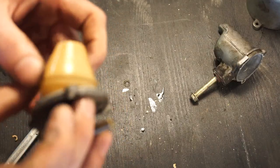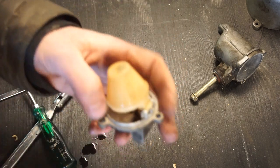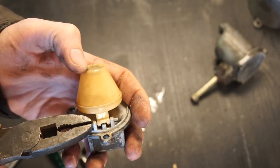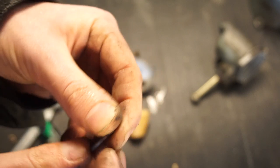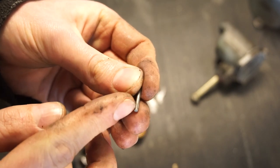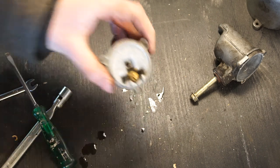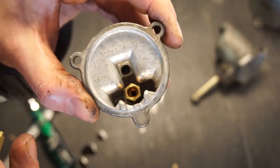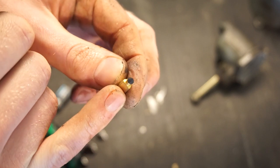The float doesn't sound like there's any fuel in there, so that seems to be working fine and not punctured. The car was running fine, but if you didn't know how the car was running before, you can test your float and see if it floats. To remove it, you pull out this pin — notice there are two sides: one has a little marking so it doesn't go through all the way, and the other side is completely smooth, so you pull on the side with the markings to get it out. Here's the float — nothing wrong with it, I can reuse it. Here's the needle and seat, which controls the flow of fuel into the carb. The seat looks really nice and clean. The needle has definitely been replaced recently — it has a newer Viton tip so it will seal really well — and I can't see any marks or dirt. It looks pretty much brand new.